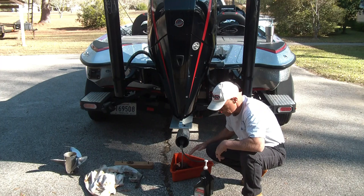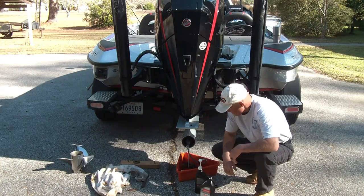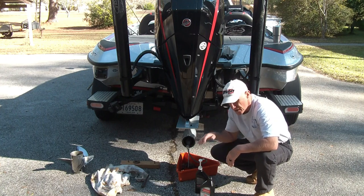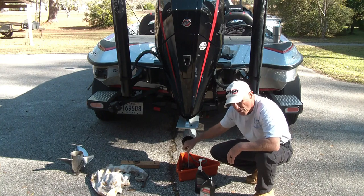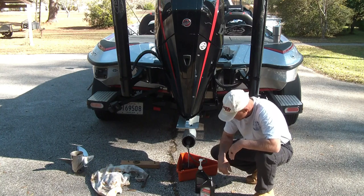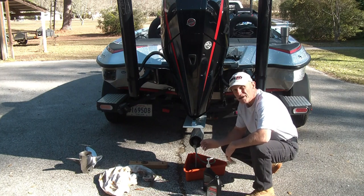Make sure you've got this perpendicular to the ground — you want your motor to be level. Just to show you what I'm talking about with this oil settling: I let it set for just a few minutes and had to pump 12 more pumps to get grease to come out the top. It takes a while for that heavy-weight grease to level itself out. I also spin the shaft a little bit — if there are any air pockets underneath those splines, I'm pretty sure it gets rid of them. We'll let it set another few minutes. Four pumps that time — we're getting close. All right, barely pushed it and I've got flow coming out the top. We're pretty confident that it's full.